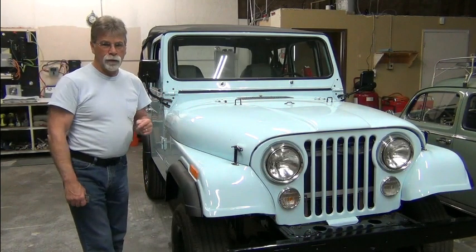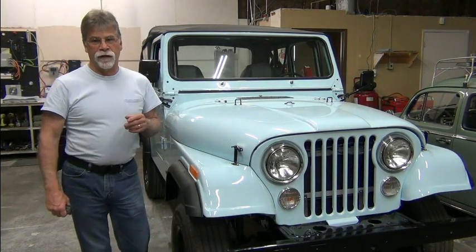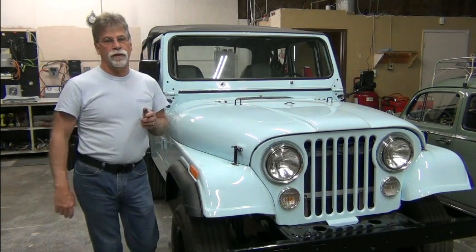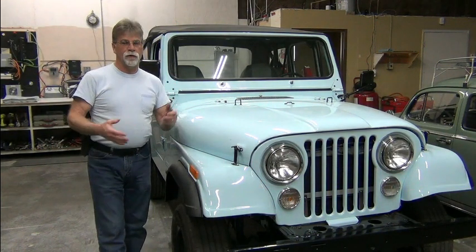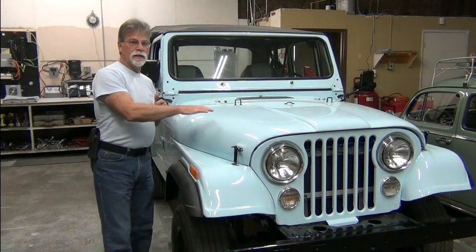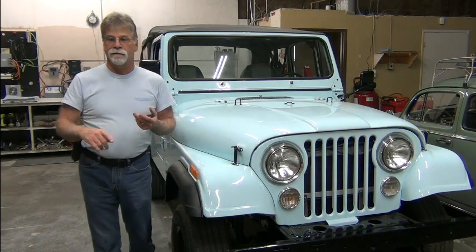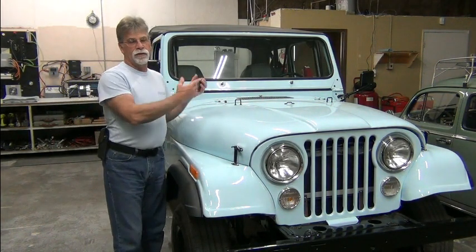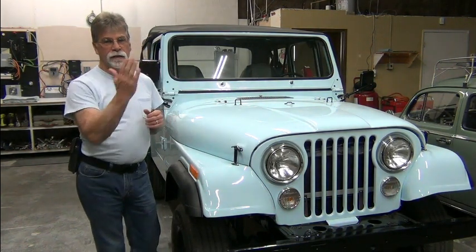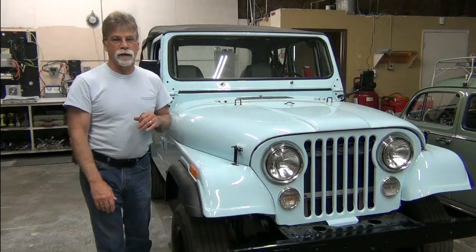In the front, we had to remove the component board, and the components weren't held on in a way that I felt comfortable with, so we removed all the components, removed the component board, put some hold downs for the cells in that front box, and shimmed up those cells so they're in there snug and held down. The board originally was rigidly mounted over those cells, and because it's an open box, there was no way to inspect, clean, or check your interconnects. None of that was available without removing this board, which is a major ordeal. So we redesigned that component board so that it hinges. You can remove two bolts, and the whole component board hinges up. You can inspect, clean, whatever.